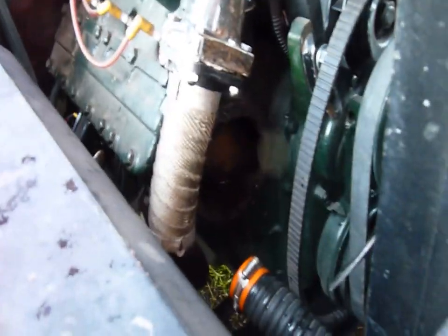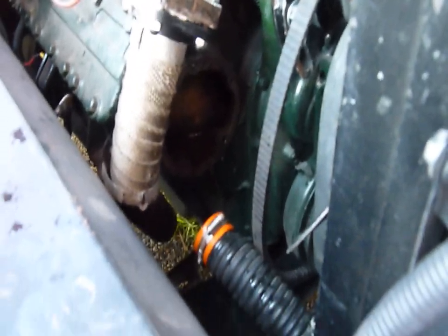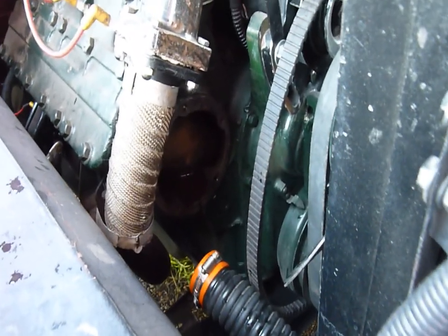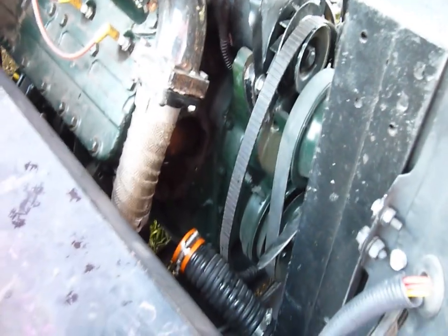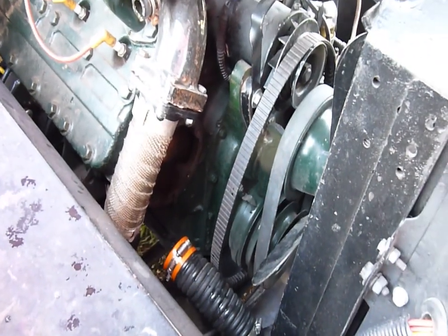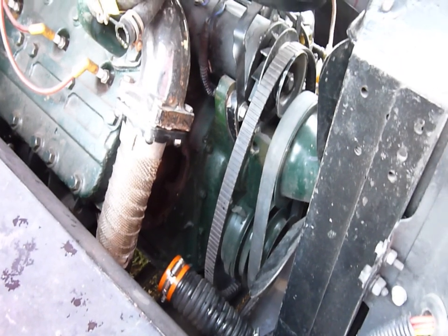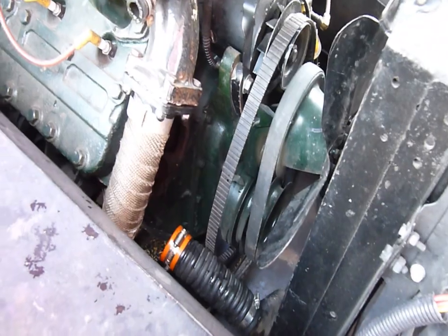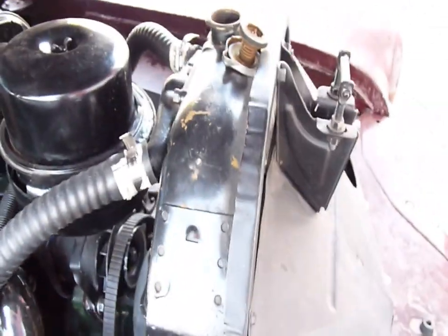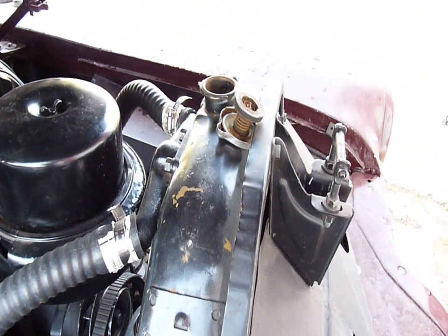Down in here in the darkness there's an opening where I had the water pump, which I've taken off. I found that the impeller has a spec of 50 to 90 thousandths and it was uneven — I'll show you that in a minute. I also noticed that the flow through the radiator was not great; it was there but not as fast as I would have expected.